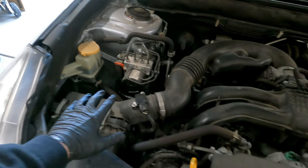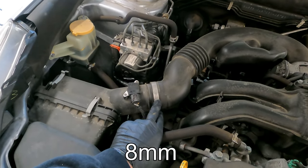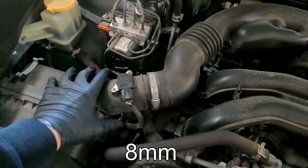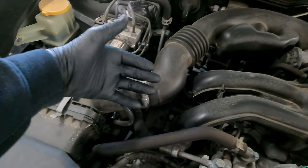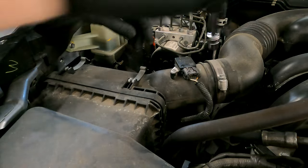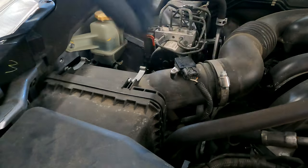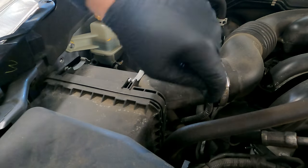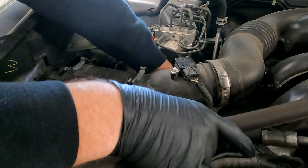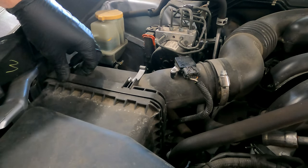One of the first things we need to do is make some room on the left side of the motor. We're going to remove the air box using a little eight millimeter to loosen this clamp and then remove this section. There are just two little clamps on the front that come off easily, then the eight millimeter loosens up just like that. There's also a hose right here that's just clamped into the side of the air box that you just need to slip out — it's really easy.